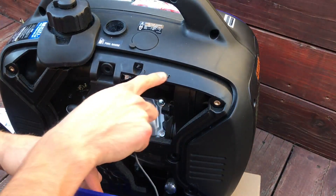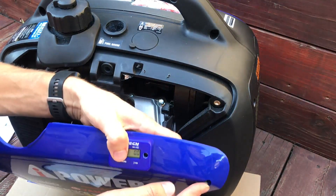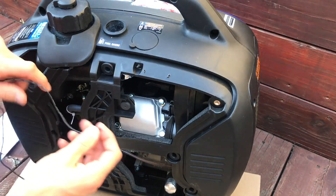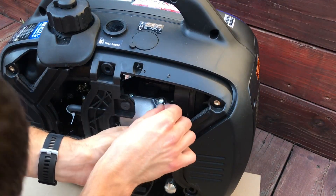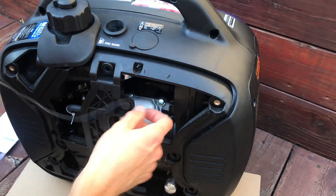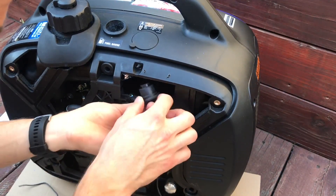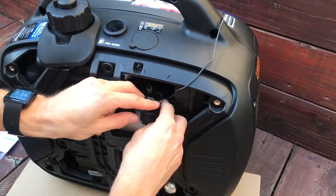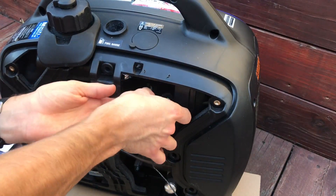Alright, so at this point you have to fish the wire through around the spark plug wire five times. The spark plug wire is really short — they don't give you very much extra — so it's a really tight space to work with. I'd consider having your zip tie handy and ready to go so that when you have those five wraps around it, you can quickly zip tie it. You really just have to have some patience and slowly wrap it around and around.